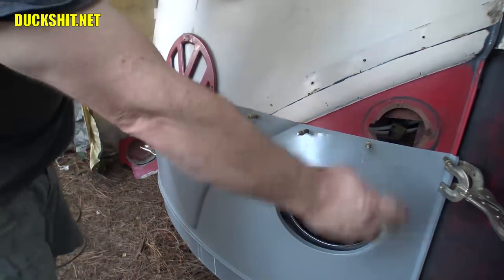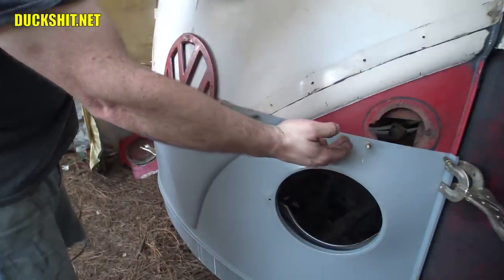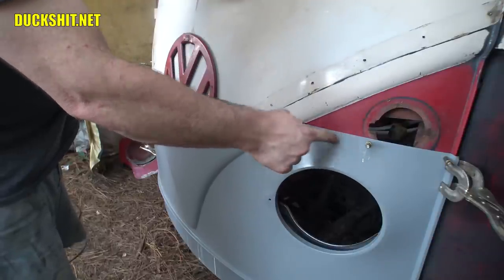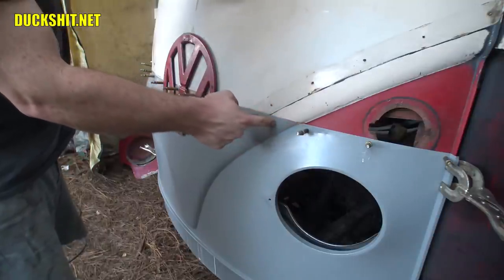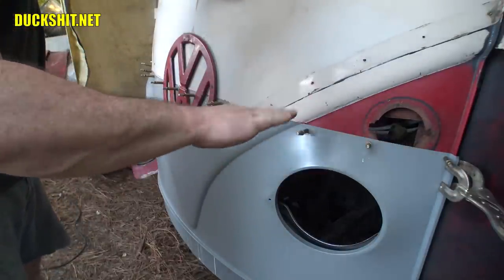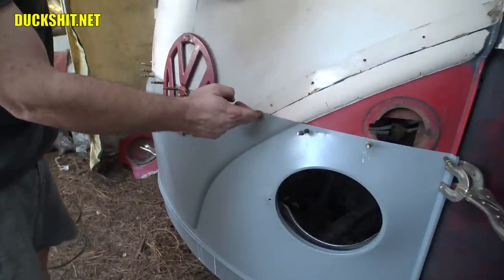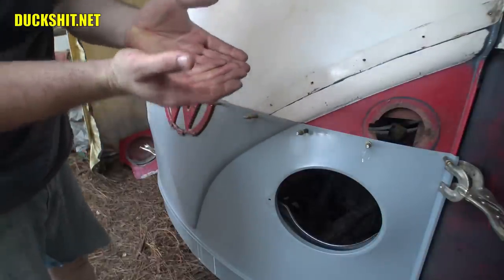once this panel is installed and I've got it the way that I want it and everything is attached on the sides, I'm going to cut right through the Clecos' holes. And as I move down this way, I will gradually fill with a couple of welds, just a couple of tacks, trim, trim, trim, right through the hole, and this will cut through both panels. So if for some reason my line is a little wavy, it won't matter because I'm cutting through two panels simultaneously, which means the two panels are going to have exactly the same shape.